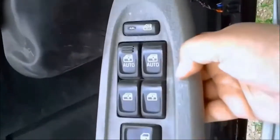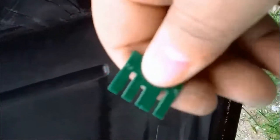Once you do that, you take off the window controller. You can pretty much pry it off — just be careful, it's got two clips on each side. Once you get that off, it's gonna have wires on the bottom. See, that's where the connectors go. They have a small green retainer clip — I think I lost it — but this little clip here goes on the device and holds the connection in place. You just pull it out carefully and it releases.